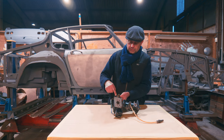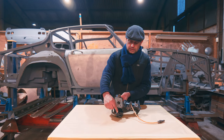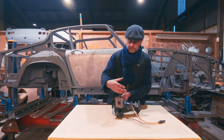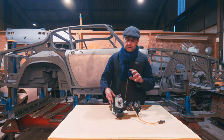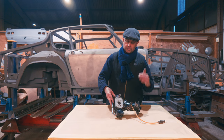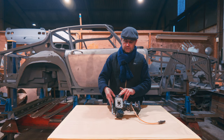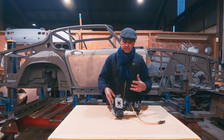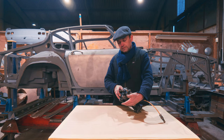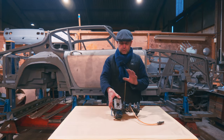This is your barometric control, which works out your altitude. And this is the actual vacuum control, which decides how much fuel trim you're going to have as you rev the engine up - effectively, open the throttles up. This is not connected to the butterflies in anything other than the vacuum. So obviously as the butterflies open, it changes the vacuum in the manifold and the depression, and that's where this comes in. It's not connected via a throttle pedal or a cable or anything else. There is a cable attached to it - that goes onto the choke enrichment piece, which attaches to your choke lever. But none of your actual throttle pedals attach to it; it works purely by the vacuum.